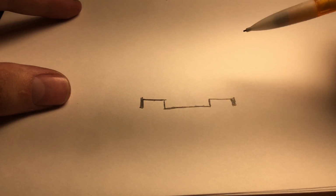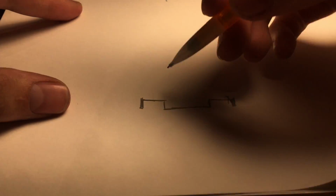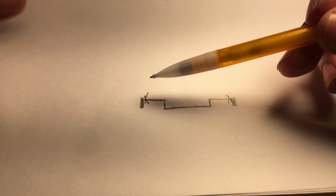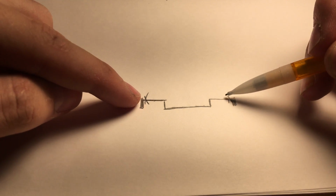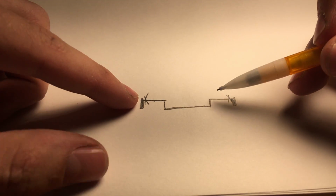Before you get into bending everything, I think the easiest thing to do is to cut these off. These are the reflectors, and they get in the way when you try to attach it to the bike. So cut them off. Make sure that you line it up with your license plate so that it still has enough, so leave a little bit of extra. You could always cut off more later, but cut those out of the way so they're not in the way while you're trying to do your bending.